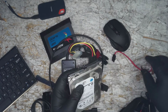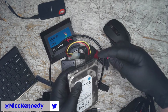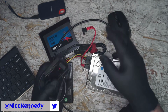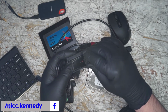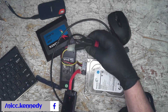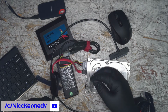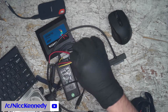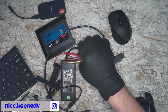So there you have the power, but you still need the data for the drive. In this case, that would be our data line, and then we have one cable further where we would plug our SATA cable in, which is fairly old, so it's only USB 2, but it would let us get our data from a 3.5-inch drive. And then USB, so you're using a split power and data connection. There are other cables, but why make everything all convoluted? It's basically both of these in one connection that lets you power it from a plug like this. It's just a simpler version of this.